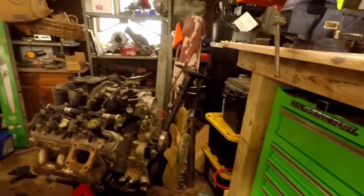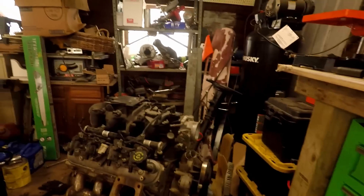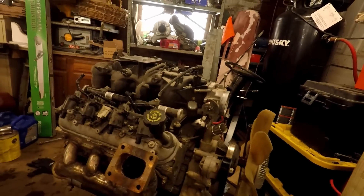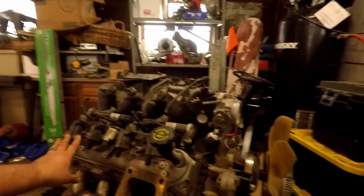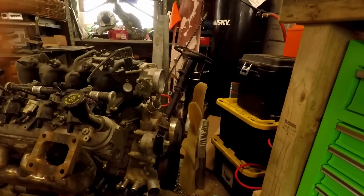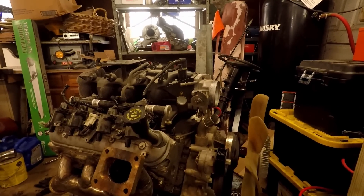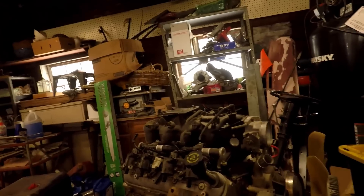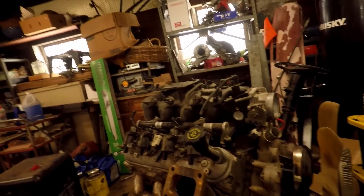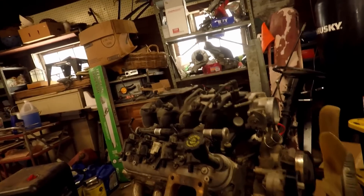The next thing I'll talk about briefly — I don't have any to demonstrate — is the up-and-forward style that everybody always wants to do, like CX Racing sells. They're stainless and they look super sweet. The problem is they hit everything — they're going to hit everything here, you're going to have to relocate your coils, they hit the oil fill, and then they put the turbos right by the alternator on the other side. People will do a bunch of mental gymnastics like, 'all I had to do was cut, weld, turn it, relocate my coils,' and end up spending $500 worth of extra work to get them on. If you like them and you already have the answers, go for it. If you need help, keep watching.